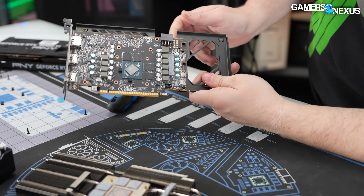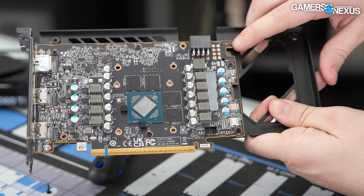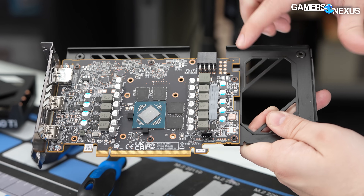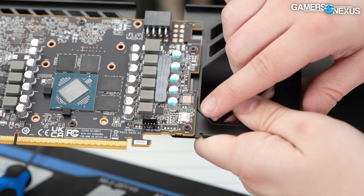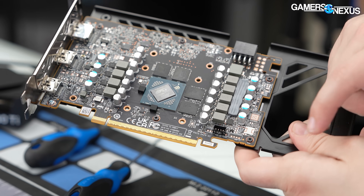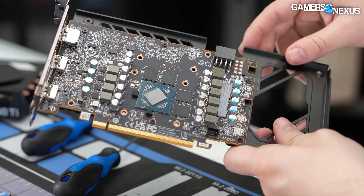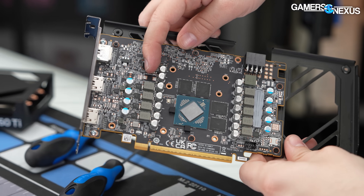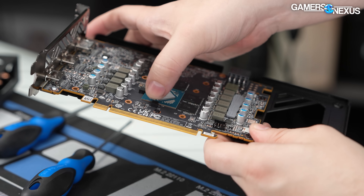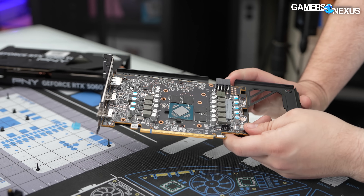As far as the board, this is probably an AMD reference board — I'm not sure on the 9060 designs yet. You can see there was an option to side-mount the 8-pin; there's the solder joint for it. They could have run two of them. There are some blank pads where they could have added additional controllers, another fan connector option, and they could have gone with the larger connector that joins LED, fan tach, and PWM. There's a missing phase up here that was optional as well. There are also two bumpers here which help with spacing and assembly alignment.